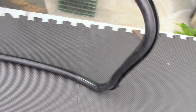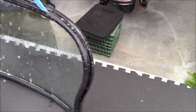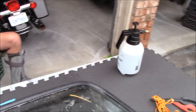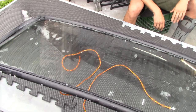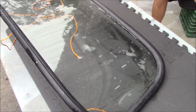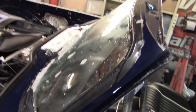We have the seal on the glass and we're just about to lube it up with some soap and water. I've got paracord here as the rope we're going to put in the channel. Seal is on, cord is in, so we're just about ready to move to the car. Elin has a link on his channel where he's doing an install on the TR6, which is obviously similar — he's using a piece of wire versus a piece of rope. You can do it with one person, but it's probably easier with two — somebody pushes it down while the other pulls the cord.